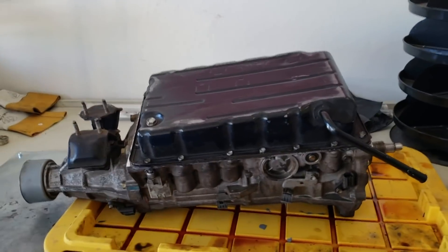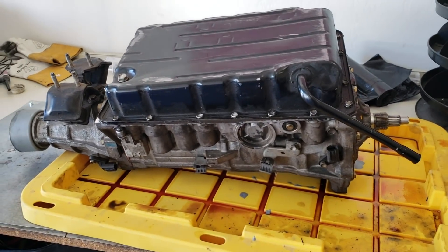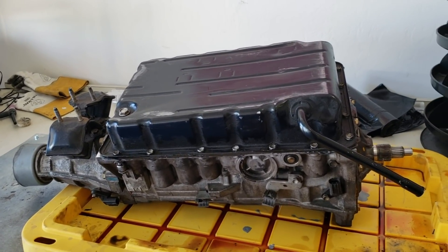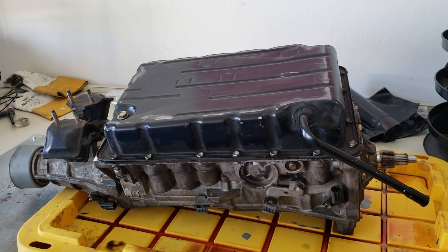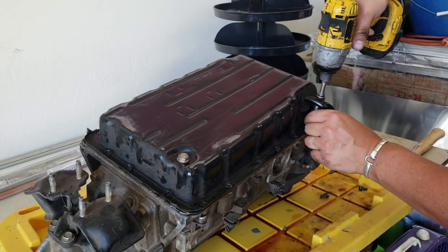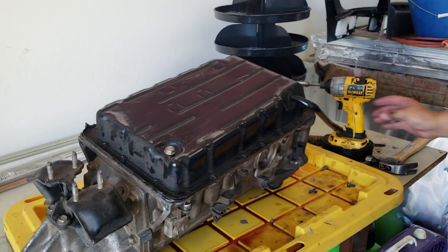What's in third gear, you can do highway pulls all you want with this modification. Now obviously the transmission is not in the vehicle anymore — we highly recommend you pull it out of the car to do this modification. The first things you're going to want to do after draining all the fluid is take off the oil pan. There are 19 ten-millimeter bolts.